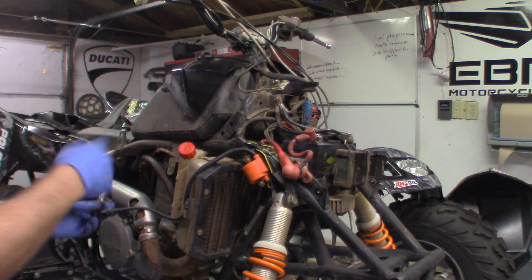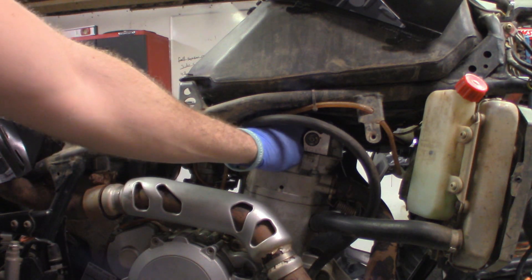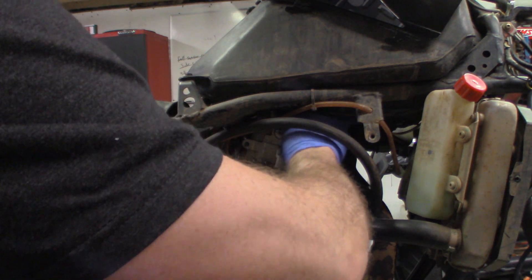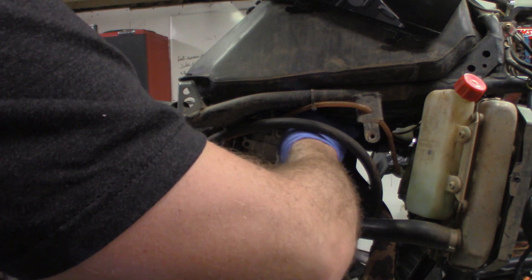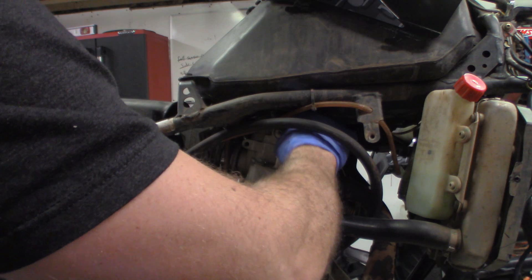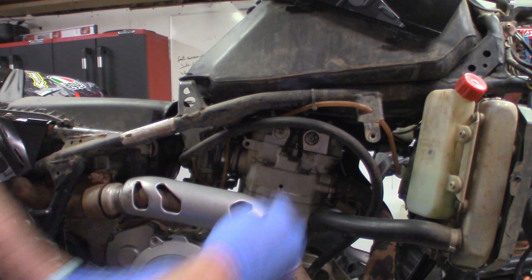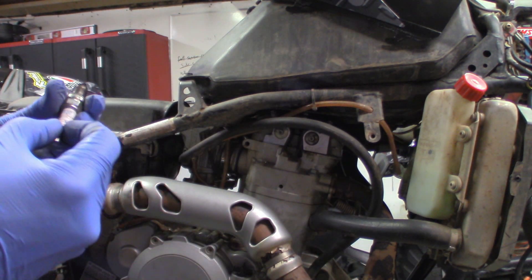So we'll go ahead and pull the other plug out and install the new plug. I just went to touch this spark plug and it's not even tight in there — I haven't touched this or anything. I'm so upset at this dealership that I bought this ATV from. I'm going to be able to pull this spark plug out with my hands. This is a freaking joke — they did not completely service this ATV. I could have started this thing up and blown this spark plug out and stripped all the threads on this cylinder.